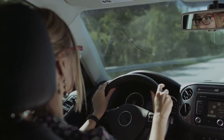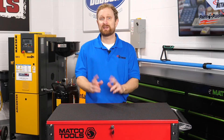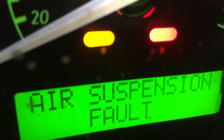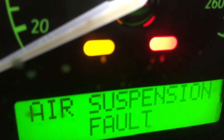For a customer with a long-dead system, the improvements will be significant, but if the customer expects as-new air ride quality from a conversion, they're probably in for a letdown. Many of these conversions also require disabling any remaining electronics to turn off the various warning lights and prevent the compressor, if still functional, from cycling.